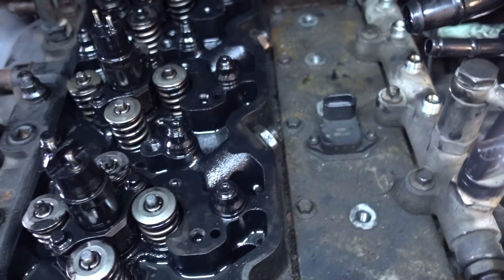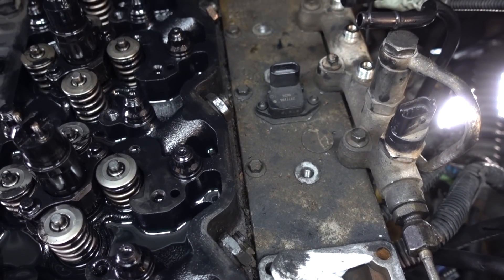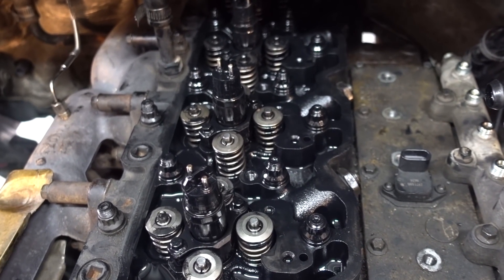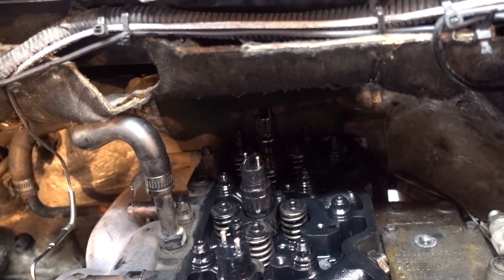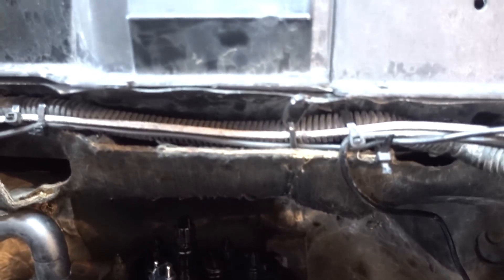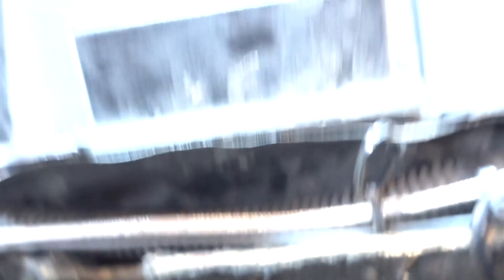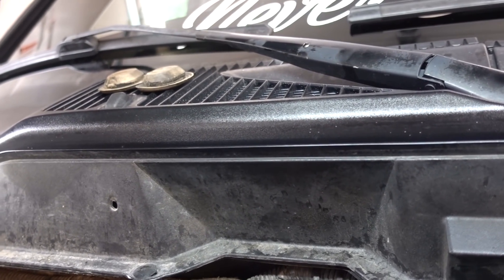Common rails are self-bleeding, so there is no cracking of any lines — just crank it a little bit and it should fire right up. The rockers will go back on, we'll put the push tubes in, and that'll be that. The other thing I forgot to mention: for the back two cylinders, number five and six, there are little cutouts up on the firewall. The push rods go up into the cowl — that's how they come out. You just put the little rubber grommets back on.